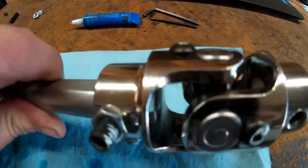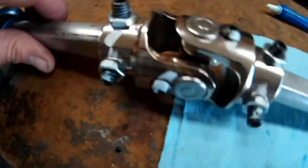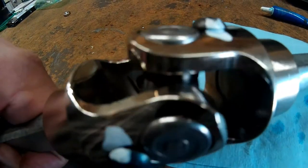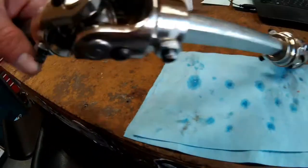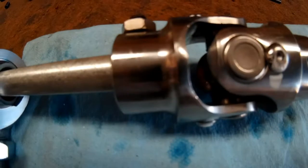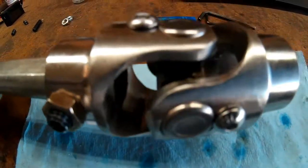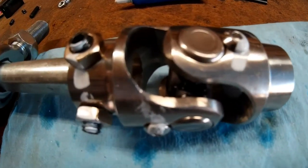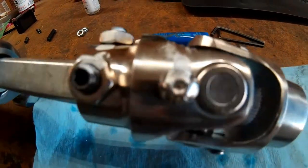Just a quick voiceover here of what I'm showing you. This is something I picked up in the off-roading world. I went through and Loctited every single nut and screw on the steering shaft assembly, and I also marked them with a little white mark so that at a quick glance you'll be able to see if one of the screws, nuts, or bolts has turned or backed out. It's a quick reference to check before you drive the vehicle or while doing maintenance.